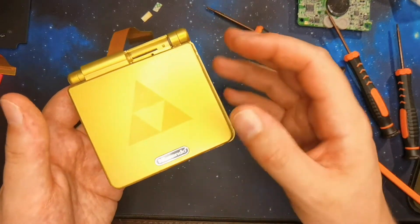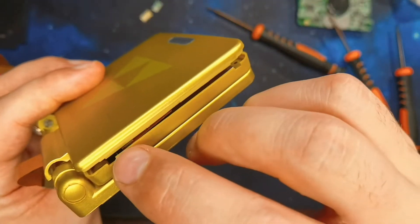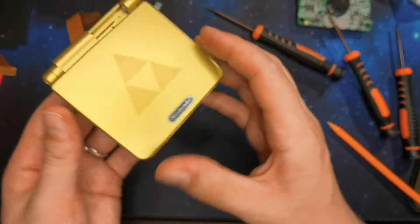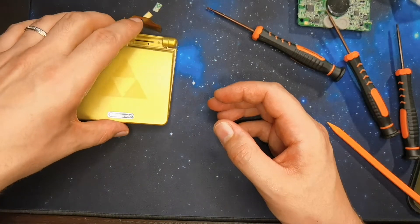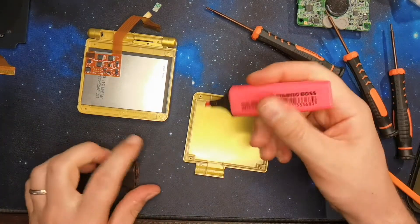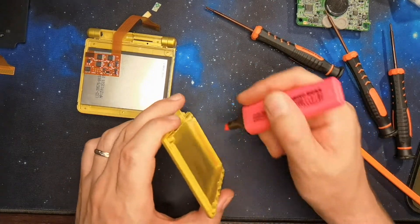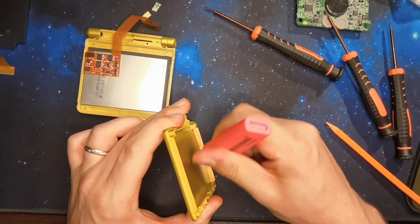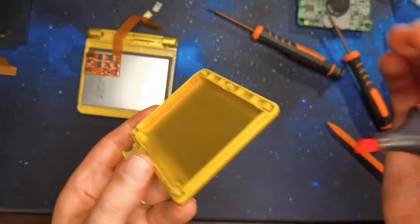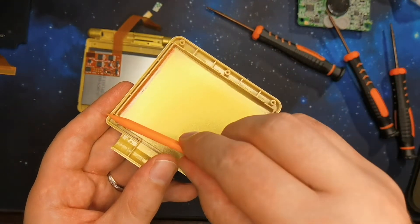As I explained, you won't be able to close the shell because of the IPS screen dimensions — the board will get in the way. We're going to remove this rib all along the inside of the screen housing. Take your shell and turn it over — this is the element we need to remove. Take a marker and mark the entire zone to remove. Don't remove everything, just the rib here — now colored in pink. Like this you can clearly see the difference. I've colored it pink so it's visible. This entire zone here needs to be removed. We'll meet just after I've removed it.